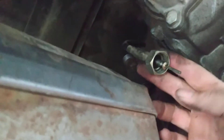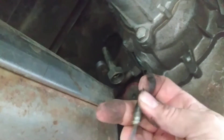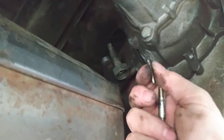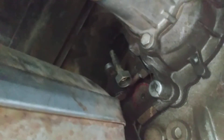This is the other end of that speedo cable. Remember I said there's a key? Well, this spins pretty easily — in fact, it spins a little too easily. It shouldn't do that, that's for sure. This is what actually spins your speedo cable, and this is the end of the speedo cable. Look at that — here's the little piece that's sheared off. I'll bet it's sheared off on your unit too. This is the other end of the key, so this goes up into the speedo cable, this sheared-off piece goes into the transfer case. There you have it — a broken cable, bad cable.